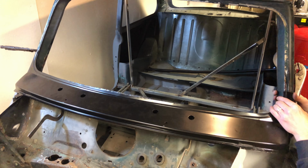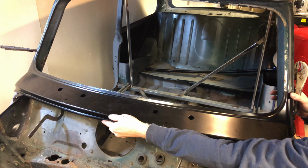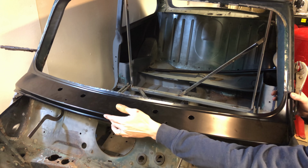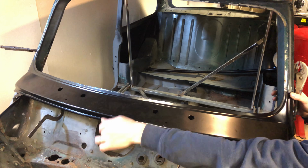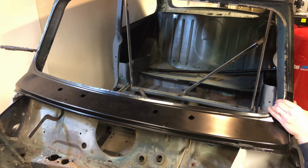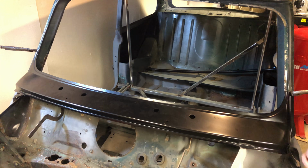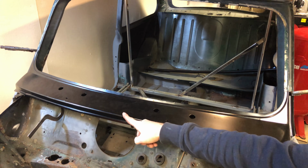And you'll notice when I pull it out of this front piece, the panel's sort of twisting and it's pulling the front piece up, which I'll hold on, and I think then we're going to get the right position here. We'll also have the right position on either side. I'll check my measurement from the front of the scuttle panel down into the bulkhead, which I've got as a data point as well. So you'll see when I pull this now, the front will pull up. So, should be pretty close there now, and then we'll check this point on the front here.